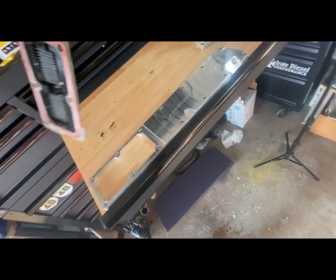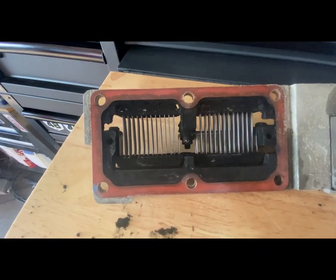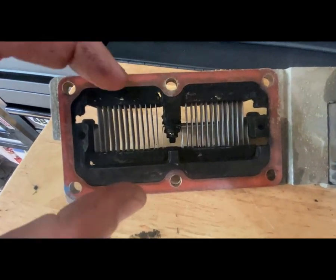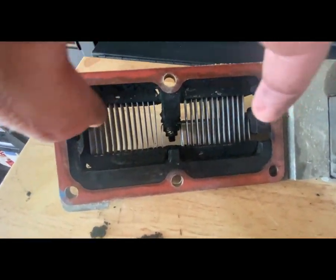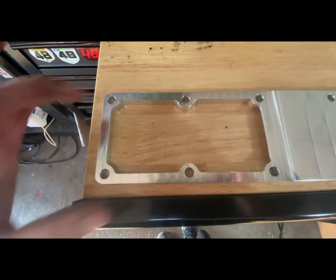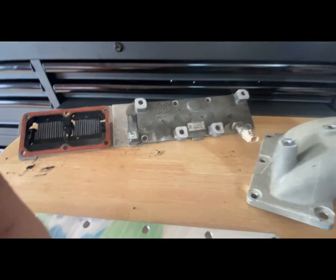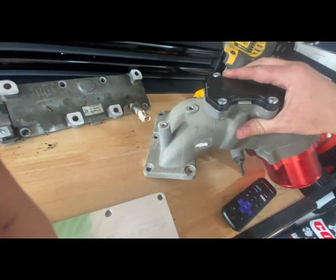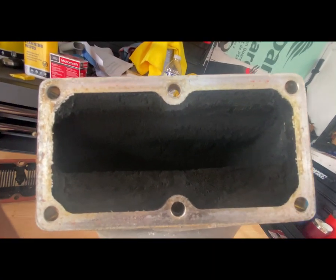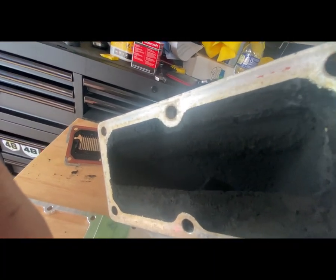So that's one reason. The second reason is obviously look at the difference in airflow. There's the grid heater, and they don't really give a whole lot of room — very minimal room for airflow. And how it really could be: this is opened up to the maximum, a much larger opening. Same thing translates into the intake horn. Here's the intake horn and you can see — this is really crusty — you can see what EGR, even at 80 or 90,000 miles, will do. That opening is extremely small. And of course, here is the new intake manifold, which pretty much matches the grid plate.